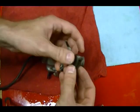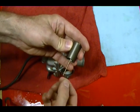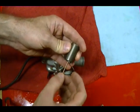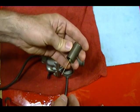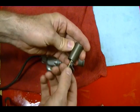When you take these slides out you want to make sure that the jet needle is straight. It's tapered, but you want to make sure it's not bent and that it fits inside the needle jet correctly — you don't want it to be bent.